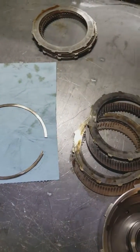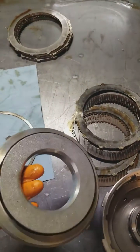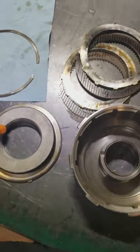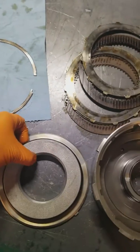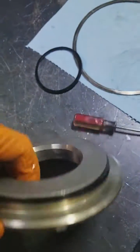But the reason for the failure — this thing hasn't been rebuilt very long ago — was the installation of the lip seal itself. There was fluid that was bleeding off. The lip seal on the transmission was actually installed backwards.